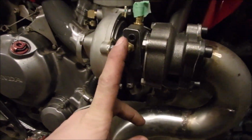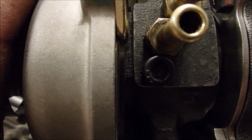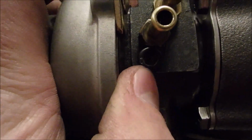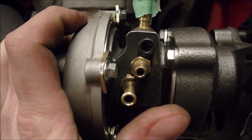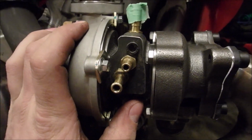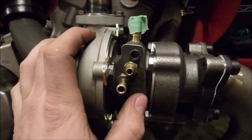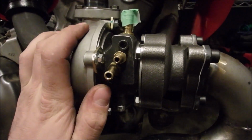I've got water cooling provision in here and it's really close. Like, I have to make sure the flat spot of these fittings was in the right spot, otherwise I couldn't get these in. You couldn't even use a hex head fastener in here because it had hit. And these two, when the points are toward each other, are only, what was it, 5/1000ths of an inch or 0.127 millimeters apart. I'll throw a picture of that up at the end of the video if I still have it.